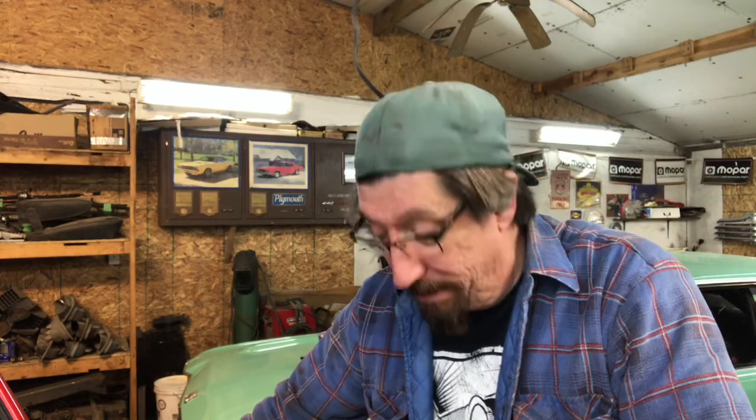Right now all my GM buddies are laughing at me because I'm used to a Mopar. You don't have to take the distributor out to get the intake off. Only General Motors would decide something that you have to take the distributor out. So no big deal. It's been a long time since I worked on a Chevy. So yeah, we'll be pulling the distributor out now.